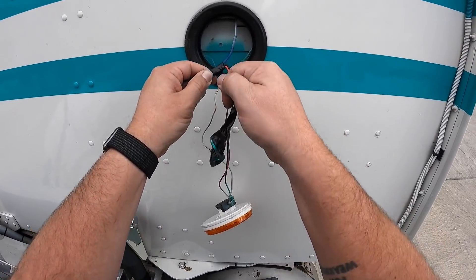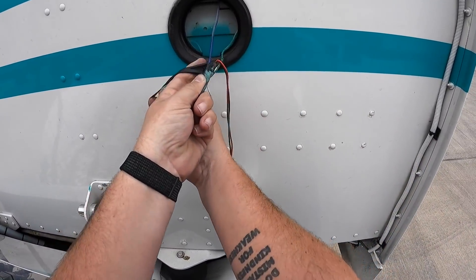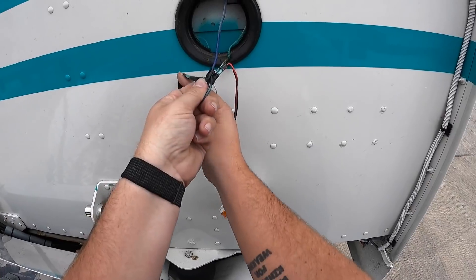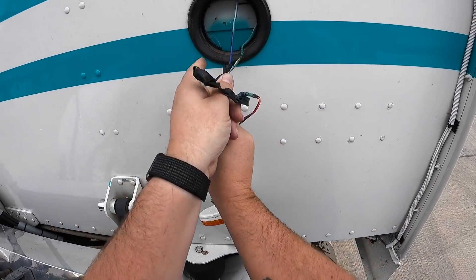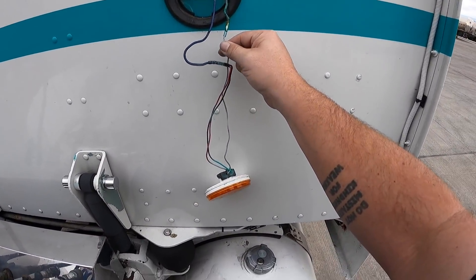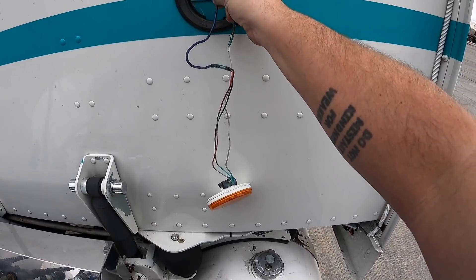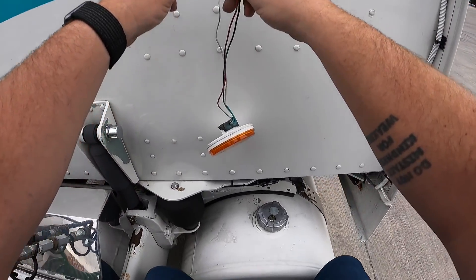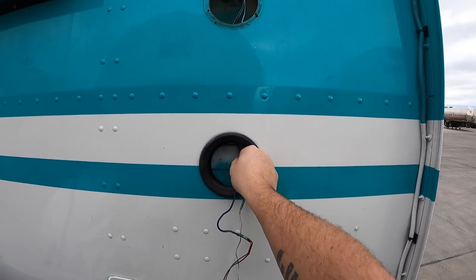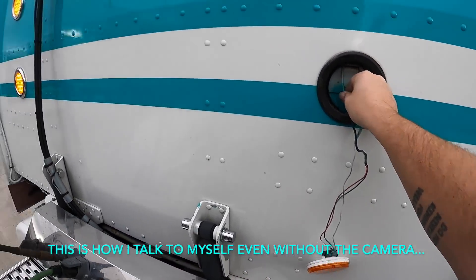Not quite sure why we got two wires running to the same spot. That black should be negative, and that red - wait, no. I always forget on trucks, your white is your ground. So we apparently don't have juice coming to this wire right here, which is an issue.